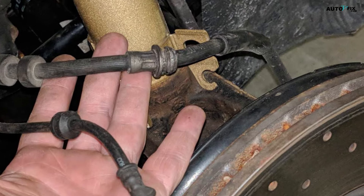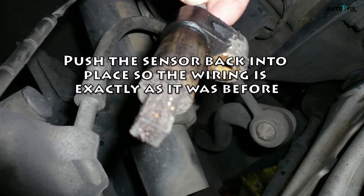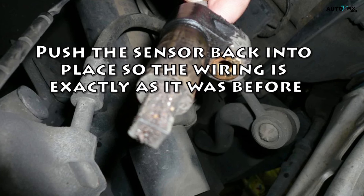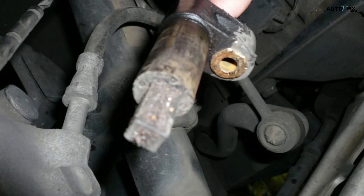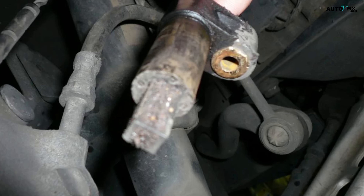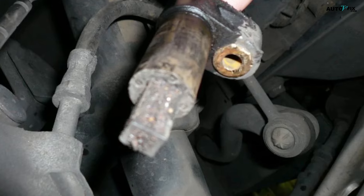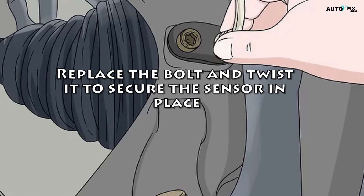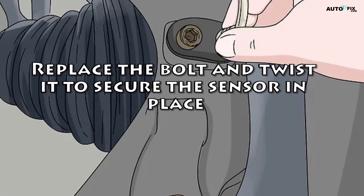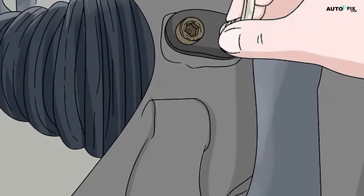Reinstalling the sensor. Push the sensor back into place so the wiring is exactly as it was before. Once the sensor is cleaned, gently reposition it and push it down to make sure it is securely in place. If you have a hard time getting it back in, there may be a blockage of some sort — try blowing canned air into the hole again. Replace the bolt and twist it to secure the sensor in place. Get the bolt out of the small bowl, put it over the ABS sensor, and tighten it with a wrench.